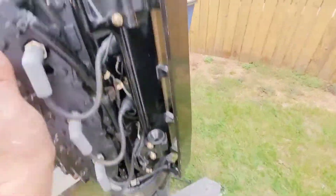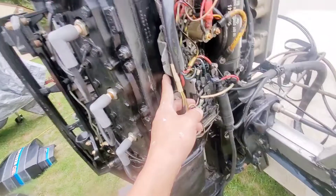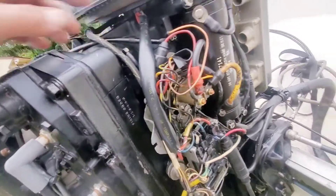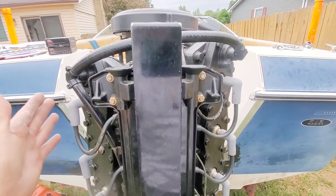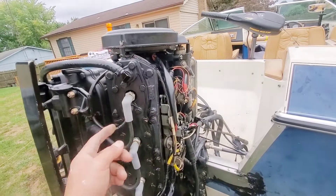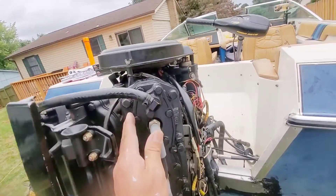So now I've got all the bleed lines secure. This is a 1982 model. Once I pulled this out, for whatever reason, this number 3 cylinder does not have a bleed line, which drives me absolutely nuts. So this is connected. I went ahead and checked the compression — it actually has really good compression. It's about 120, 125, about 120. This is the only questionable one at 95 to 100. Then you've got 125 and 120 down here.